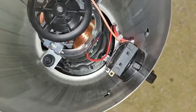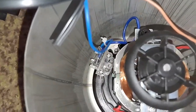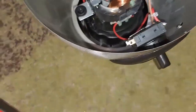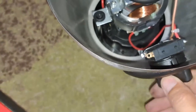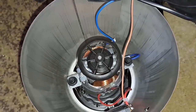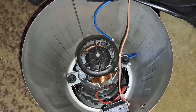Shall we see if it works? Like I told you guys, I just bent that contact plate a little bit and put the switch back in its place. There's our main switch — nothing is touching. And that's how you fix a blender!